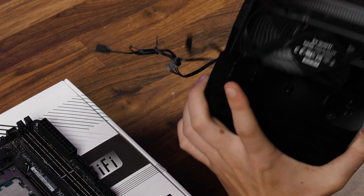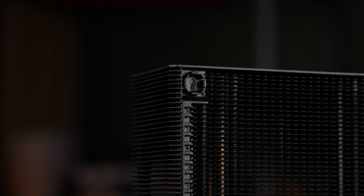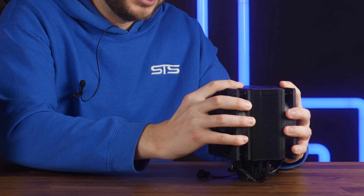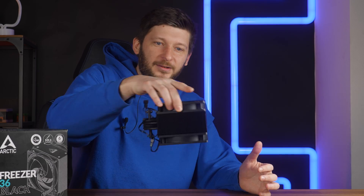What I'm really talking about is how everything is mounted. For quite some time, a lot of companies have tried to get rid of fan clips — Be Quiet had the plastic kit of 3000, Arctic had the Turtle Destroyer, Deepcool had the Minecraft block. But this time they didn't do an oopsie. On the heatsink, Arctic has these plastic rails with holes at the top and bottom. On the fan side, there are special screw-like things pre-mounted with a tiny indentation. You just position the screw on the holes and pop them on — the whole mechanism is strong enough that I trust this completely.